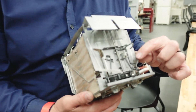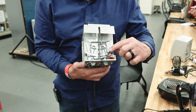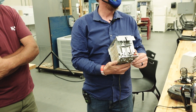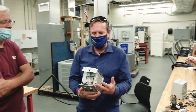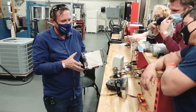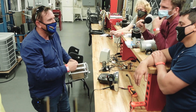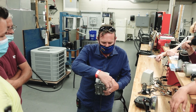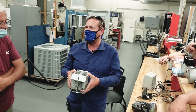But if there was never any heat, would the timer ever work? No, you'd sit there all day long. So what happens is, when it warps enough, it touches this piece of metal. What is this piece of metal connected to? A coil — also known as an electromagnet. It's an electromagnet. So when it warps enough, it touches this electromagnet. Guess what this electromagnet pulls in right here? This little piece of metal. Isn't that awesome? It's HVAC — there's so much HVAC components in this little piece of equipment. So we pull this down, it closes our contacts, we have energy, a full circuit, a resistive heat element — it's getting hot. Our bi-metal starts to warp. When our bi-metal warps enough, it energizes the electromagnet. The electromagnet pulls the switch and it disengages the circuit. The spring pushes it back up. It's an HVAC component right here.